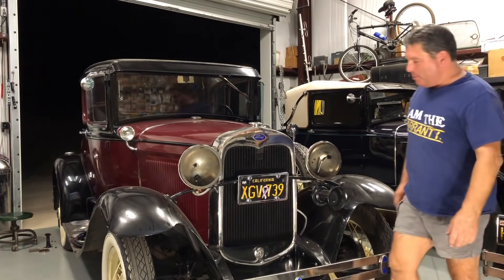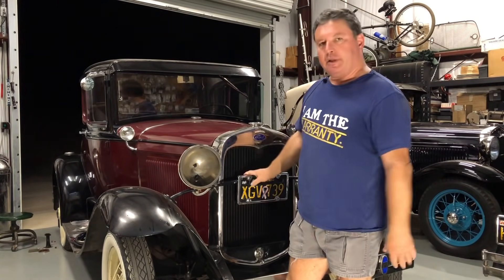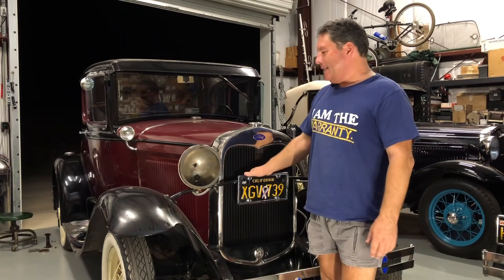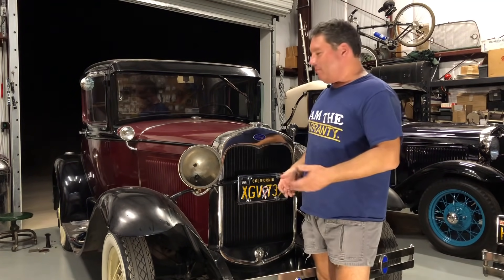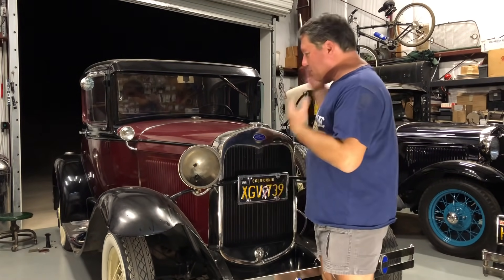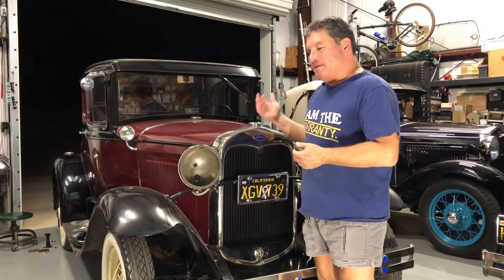Hello friends, welcome back to the Boomer Box and for this edition of Operation Hooptie — after pulling all the old wiring out of this car in the last episode and deeming it 97.3% Hooptie free — I don't know if we can call Athena Hooptie anymore. Maybe this is just Operation Model A getting it back on the road. In this video I'm finally putting in the wiring, and I'm also converting this back from 12 volts back to 6-volt positive ground, just like it left the factory.